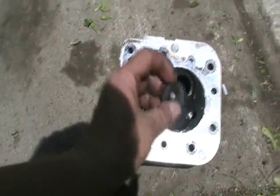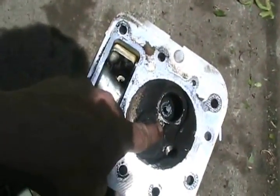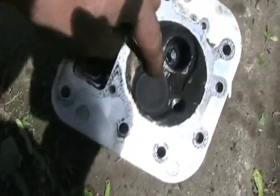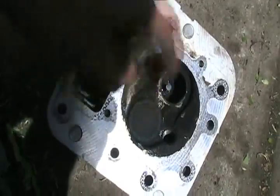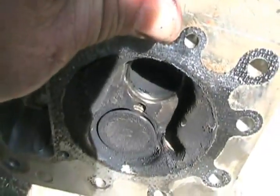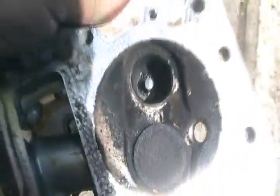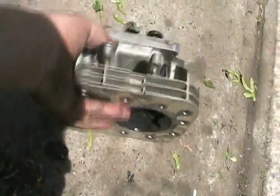Well, more bad news. That piece of the valve post hit the head right there and put a big indentation — it indented it so much it squished in the steel valve seat, so it's all warped. Even though the valve may not be bent, it's sticking out and not closing because the seat is sticking in and hitting it. So the head's no good — this guy needs a new head.